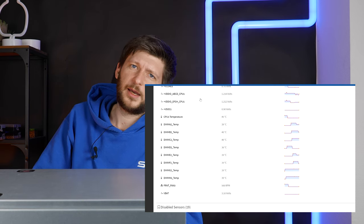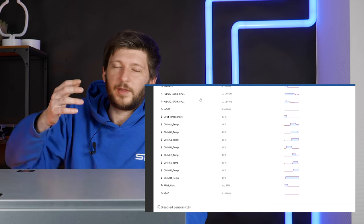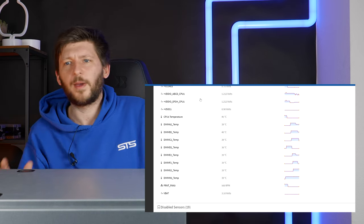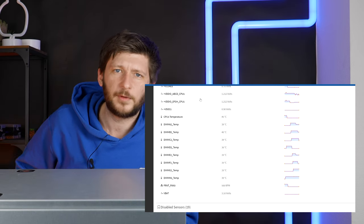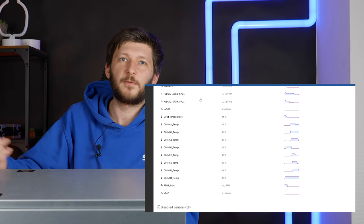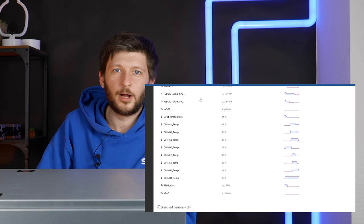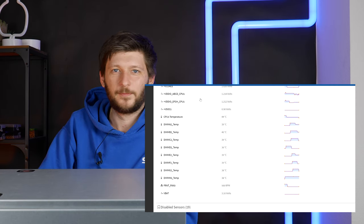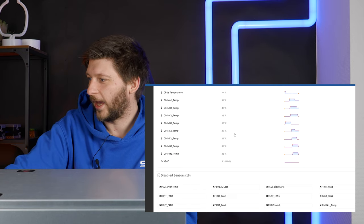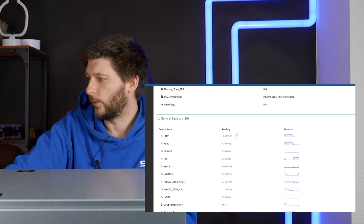And that's the same thing I did on my previous server. I can downclock or turn down everything that I can. Sometimes you have in BIOS performance mode and max performance mode and power saving mode. And if it is just there to serve me files using SMB, I can also disable half the chip and it will still function just fine. As long as I'm not running VMs or anything heavy on it, I think I can get those numbers down without actually doing anything.